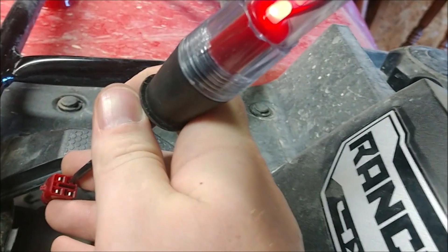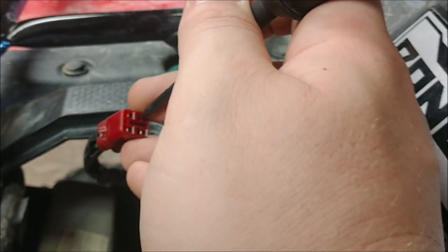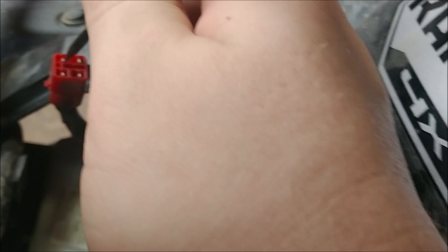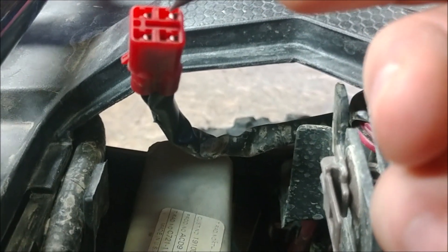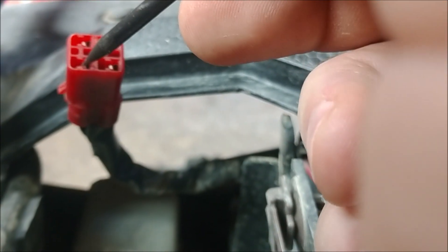So we're going to go with that white wire. After checking with my voltage meter, the white wire — which you'll see from the back when you peel the wire away — and the green one is ground. The other wires don't appear to be grounded. One might be for the brake lights, I'm not really sure. Either way, the white one is 12-volt key power and the green one is ground.